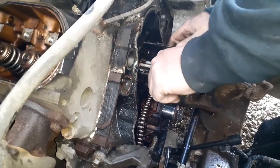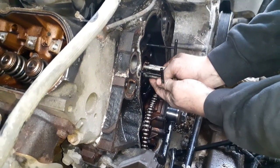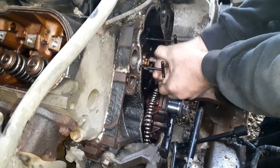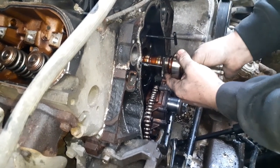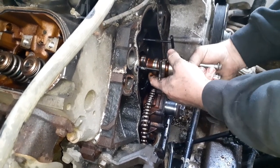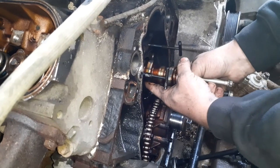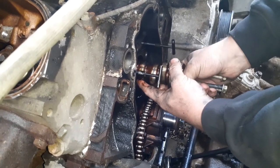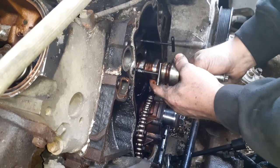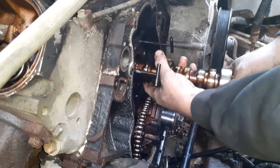Spin and pull - spin and pull. And out comes the cam. Kind of spin and pull, and then it'll fall down, come out of the cam bearings. Then you've got to kind of wobble it back up into the cam bearings - try not to ram your bearings. Kind of straighten it up, line it back up in the cam bearings and pull through again. First time doing it it's a little tricky, but after you've done it a while you can pull those out in two seconds. You've got to be kind of easy when you pull that through - you don't want to knock your cam bearings.